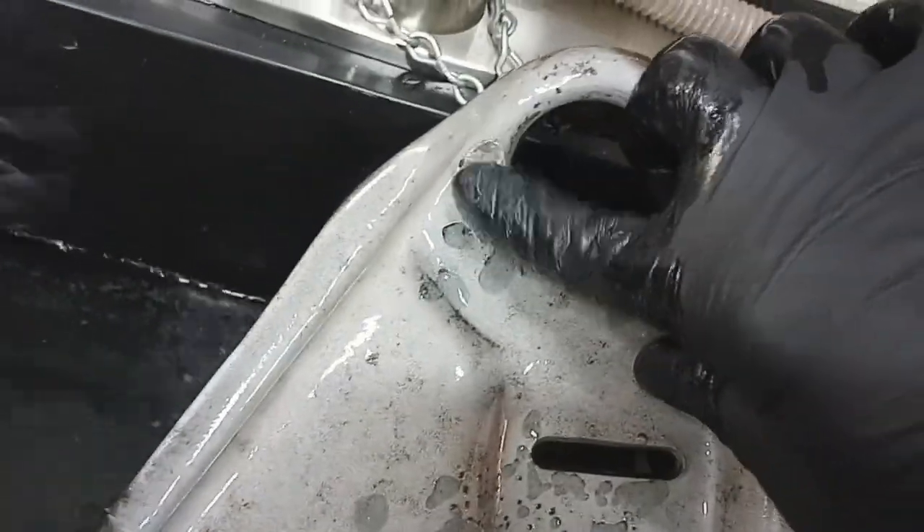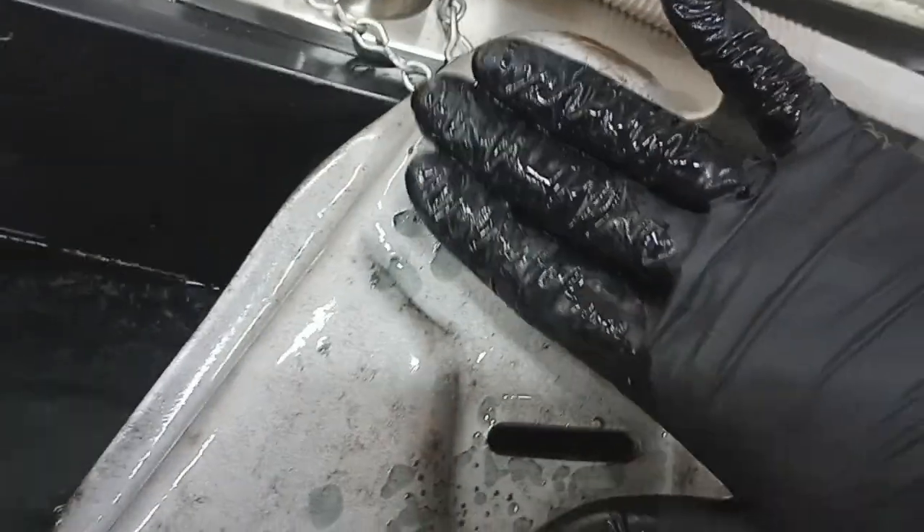The upper control arms actually still had the original ball joints — you can tell because they were spot welded in. I had to grind the spot welds off because the new ones are going in, and you want a nice flat surface for them.